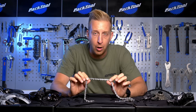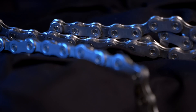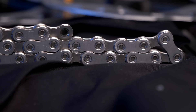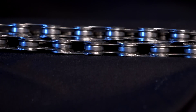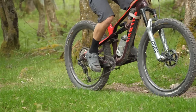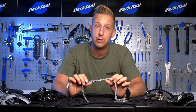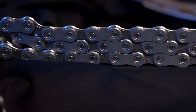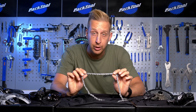Like the XTR, there's a dedicated 12-speed chain with its own dedicated link. You can't use this with anything else in the Shimano range — it has to be for 12-speed exclusively. The XTR version is about eight grams lighter and has hollow pins, whereas the Shimano XT version has solid pins. They have longer inside links, known as the dynamic chain engagement system, which helps the chain sit much better on the sprockets and chainring. Essentially, it reduces vibration, because vibration equals noise and noise equals friction — giving the smoothest and most accurate shifting with the least amount of friction Shimano has done to date. It's a directional design, so make sure you don't install it upside down or you won't be enjoying all the benefits.